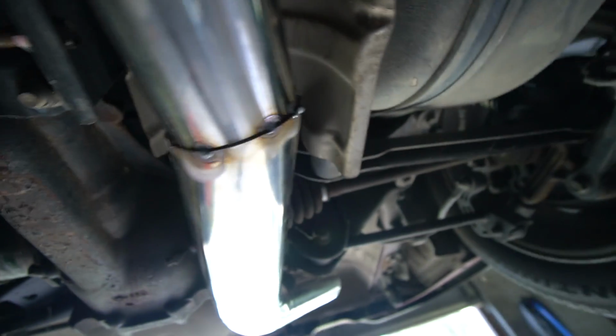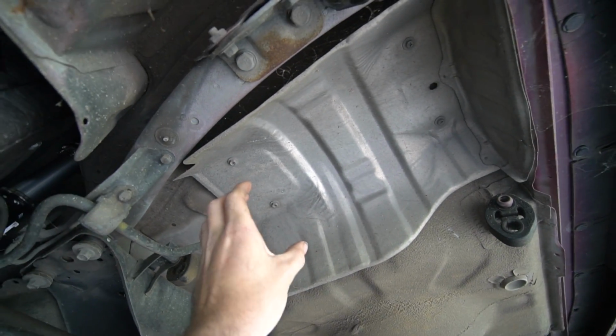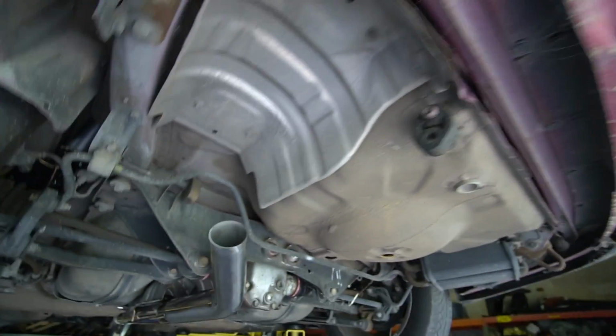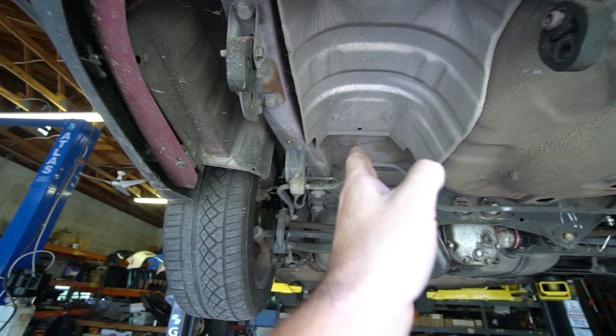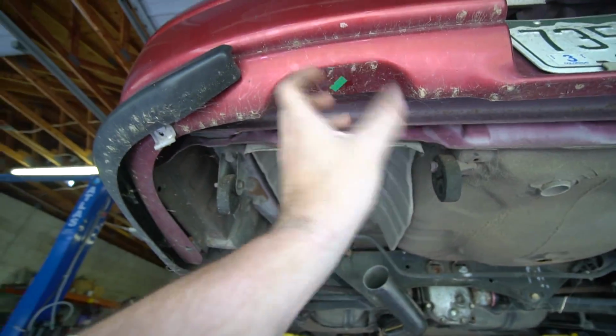All right, guys, check it out. We are almost there. We got our 45 in. It's a very tight fit in here with everything. It's a little meh fit up because I cut a 15-degree angle, so basically it's wider than this is with no angle cut, so it's gonna be a little tricky to weld, but I don't think we'll have too much trouble. So then our next one will come up to about here, then it'll be the 45 and then out to here. And once we can get that, we can get our turn down tip. So basically we just need to figure out how far to leave the leg on the 45 to end it up center or close to center.